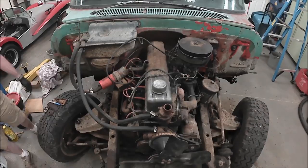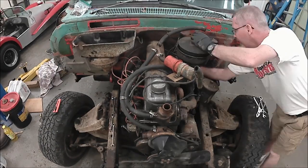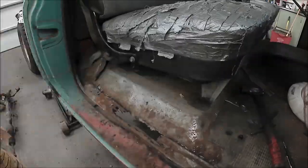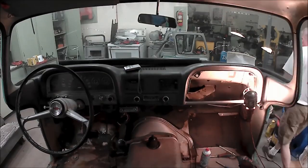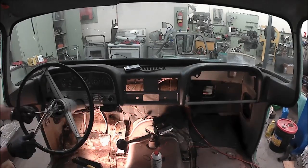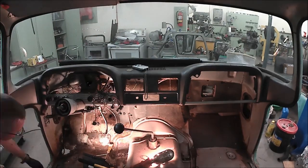Pulling the front clip off to the side, the hood's off to the side. As far as I can tell, this engine's never been apart before, and the transmission's never been out. The transmission came out through the cab, and the high hump floor panel has never been unbolted to get it out. You can see a bit of the rot in the bumps on the side of the cab — it's not bad. Lots of video, trying to put stuff in Ziplocs, organize it so I know how the heck it goes back together, because it's going to be years before I put this thing back together. The gauge cluster comes out. The wiring harness is simple. I'm not really keeping track of the harness because I'm not interested in putting 60-year-old wire back in the truck — I'm going to put new fresh wire in it.